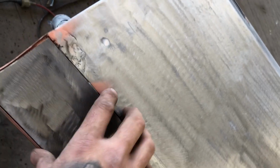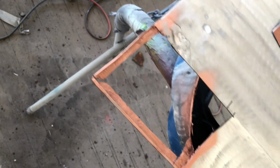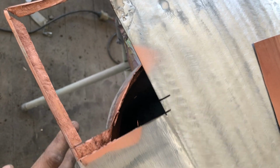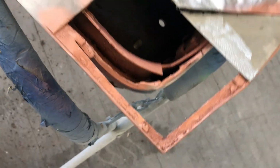So here's the door here. Got the section here, real nice. Pop it out. Oop, bit wet still. The weld through primer on it. As I said before, cut out the inner section as well. Cleaned up around the edges, got that piece ready to go in. Same thing at the front here. Got a little piece here, weld through primer. Cut out the inside. So that's all ready to be repaired as well. And this little piece here, I wasn't really happy with that section of the door.